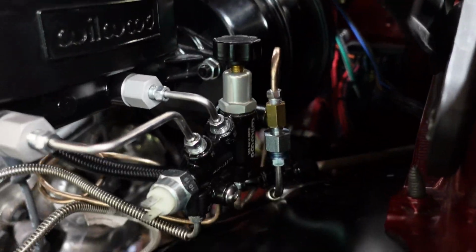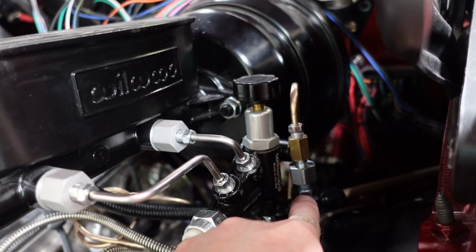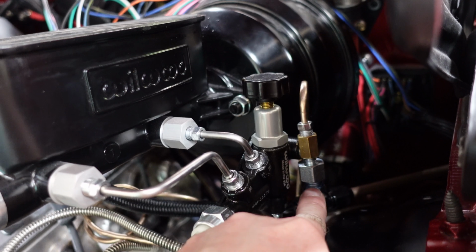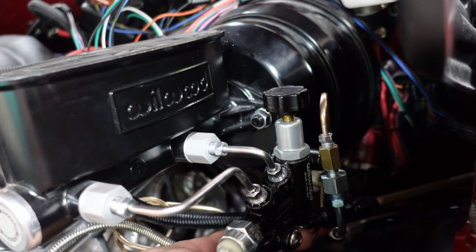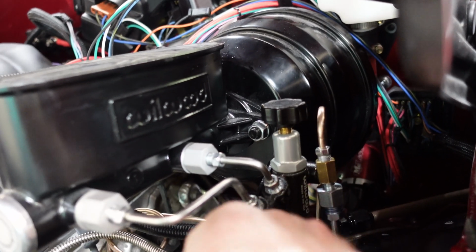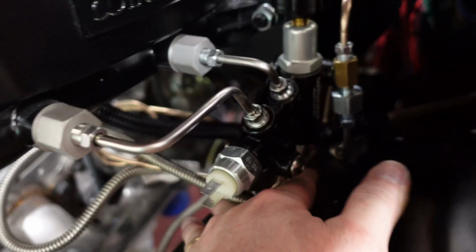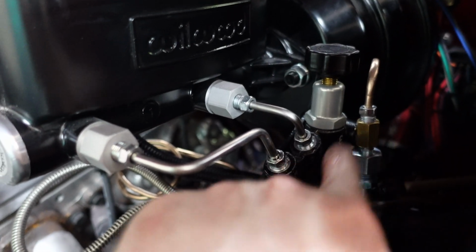It was. So, Pops and I were discussing the ideal solution for this, I think, if anyone knows if such a thing exists. What we want is a flex line with a female 5/8 or whatever this is, and then a male 3/16 here. That's what I want. Because then we can just go straight from this over to here with a flex line. You see, I had to build this funny little thing here because the proportioning valve is 3/16. And there's not enough room under here to stick something under it. So, brake fluid. So we need something to go from here to here.